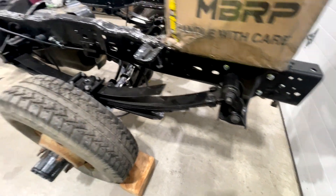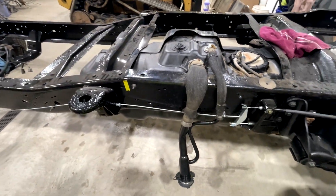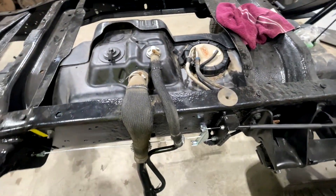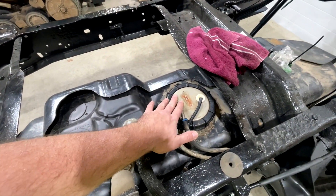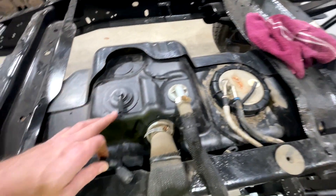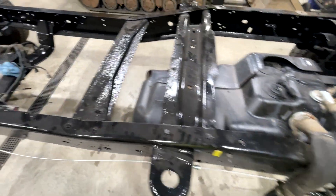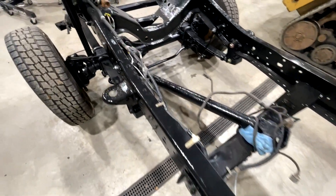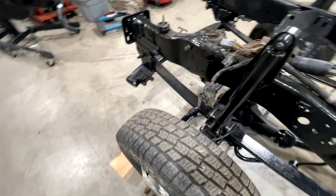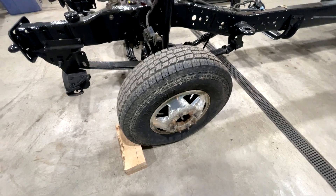New hangers and shackles in the rear, new hangers up here in the front. Still using the old filler hoses but it looks like that's got a new filler neck. We went ahead and pulled the fuel pump out to make sure the foot on it was good. We have to run new vents for the fuel tanks — you can see the hose is dry rotted off, which is no big surprise. Drive shafts are all painted up and installed, though we'll probably have to do some more work. It needs new four-wheel drive lockouts and one wheel bearing.